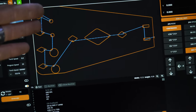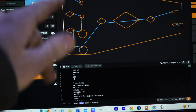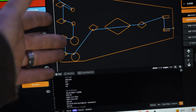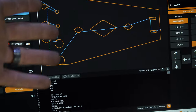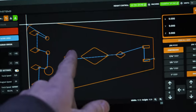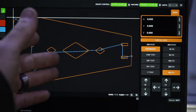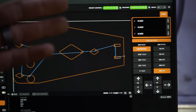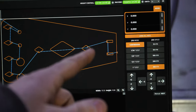I'm not sure if we're gonna be using those holes, but I want the option to if I want to. These 2, there's like 2 flat studs that protrude from the unibody. We're gonna be welding to them, but that's so the piece doesn't interfere with them. These 2 are just for design and to take some weight out of the piece. And then those 2 up there are gonna be so we can weld from the backside to the coilover mounts.